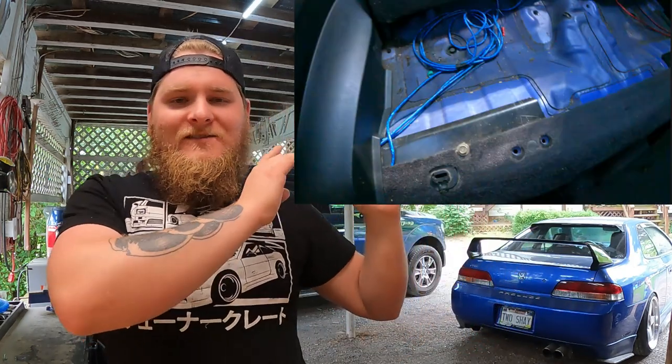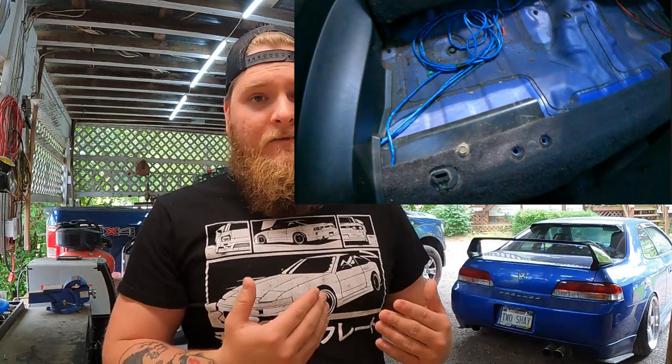The next thing I messed up was showing how I got the measurements and did the rear deck panel while I was in the car. So here in the picture — if you take your rear seats out of your Prelude, you'll see a black plate with a plastic piece where the rear seat has a little metal loop that clicks down. When you take your seats off you pull these pins out and lift the seat. That metal plate — unbolt it and take it right out. I think they're 17 or 19 millimeter bolts. I use those spots to secure the rear wooden deck down. Two bolts on each side worked flawlessly.